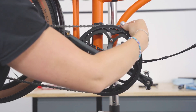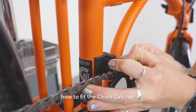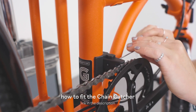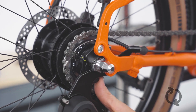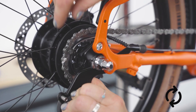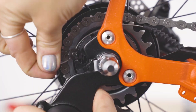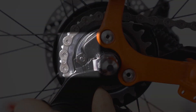Refit the chain onto the chain ring, then reinstall the chain catcher arm. For detailed steps on how to do this, click on the link in the description. Push the gear cable into the cable clip, then rotate and hold the assembly tab in a clockwise direction to engage the gear cable. Be sure to align the flat sides of the cable nut in its designed slot.